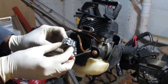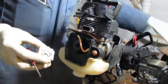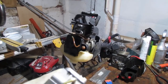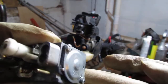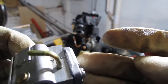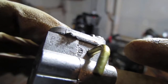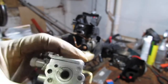Now this carburetor — it's Zama. It's a P-2-2-A-5-4. The carb information — first off, it's Zama. The carburetor is very well labeled. Lucky us. It's P-2-2-A-5-4-A. So that's good — we've got a lot of good carburetor identification information.